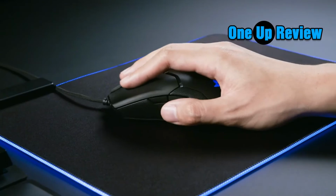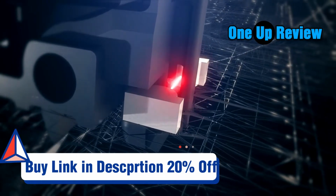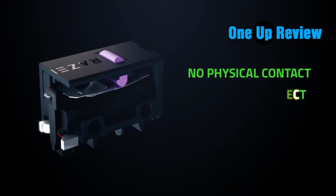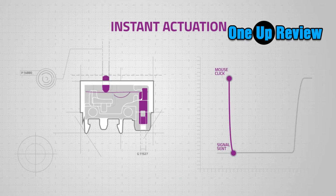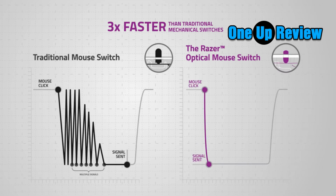When you click on the mouse, the switch shutter opens and the infrared light beam passes through, sending a signal to your computer in an instant. No physical contact is needed to send electrical signals, so there's no bouncing effect and no need for debounce delay. The result? Instant actuation and a response time of up to 0.2 milliseconds. This is 3 times faster than traditional mechanical switches.